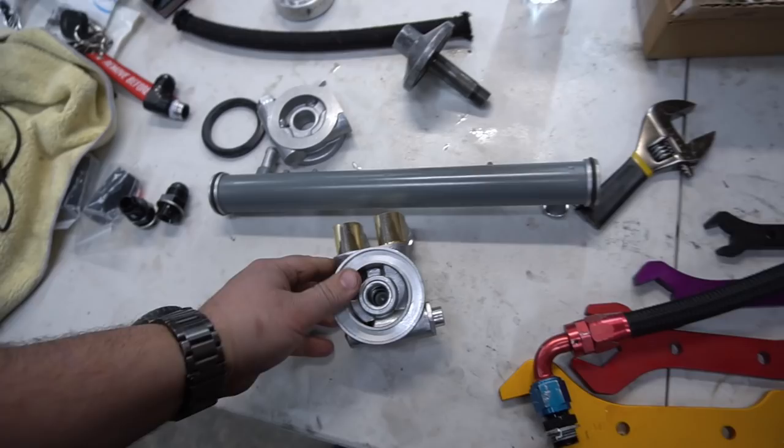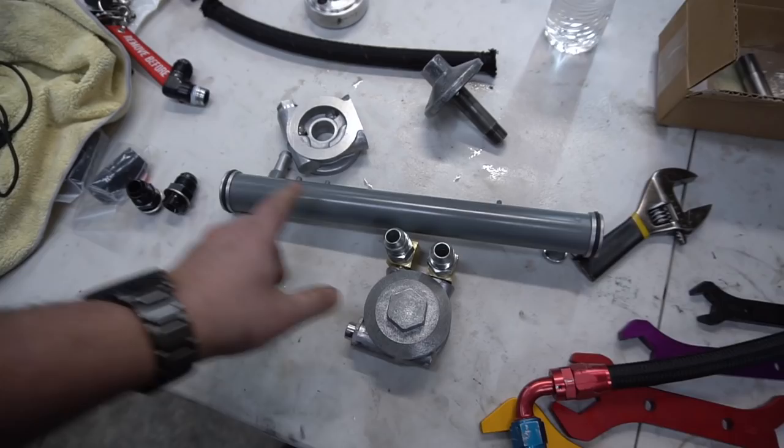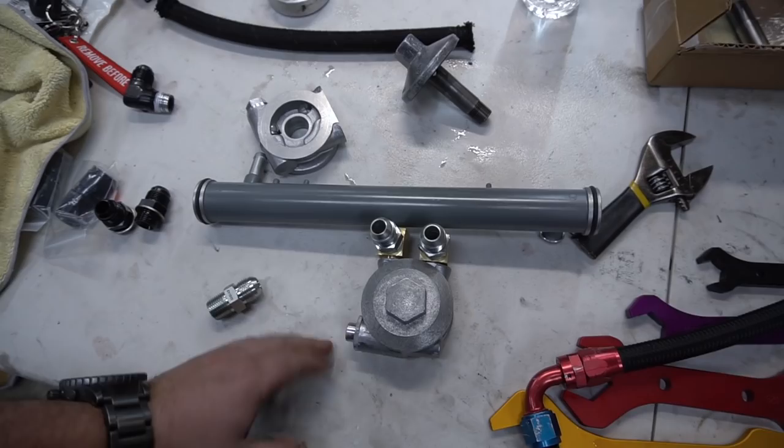And where did I put that seal? Oh, here we go. I got to re-lubricate it on, but now you guys see it. So this will work now without needing a spacer. We'll clear the coolant pipe that travels from the water pump to the thermostat housing on the 12-valve VR6. And we shouldn't have any issues. And then we'll just bolt right up to these.